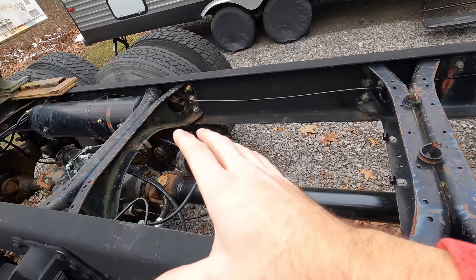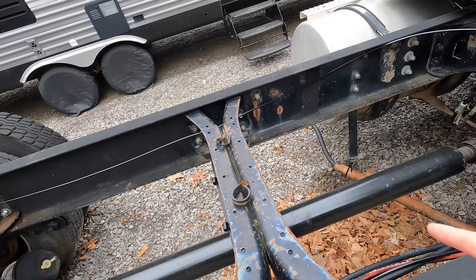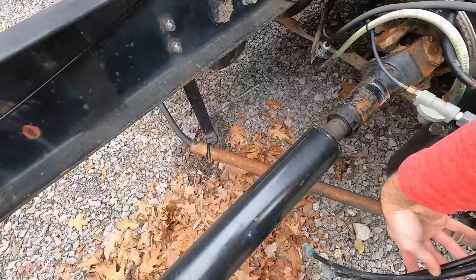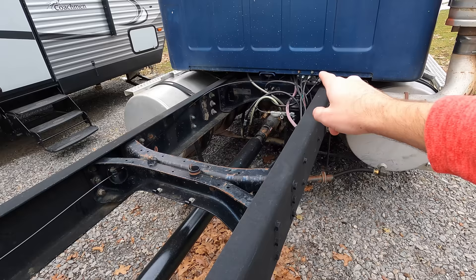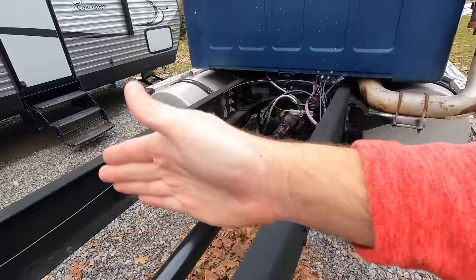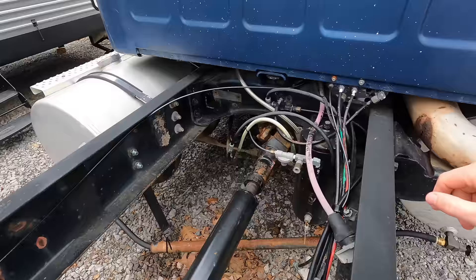Back here we had to get the drive shaft lengthened because the frame was shortened and we lengthened it, pushing the axles back. It's the original drive shaft — just lengthened. We've got electrical and air connections here for the trailer, but we still have work to do because the sleeper is going in this area, so all those connections have to be relocated to the back of the sleeper. We'll replace that wiring and those air lines, and there was a corrugated deck plate and a pogo stick to manage all the electrical connections and air.